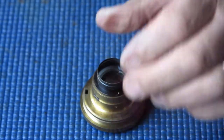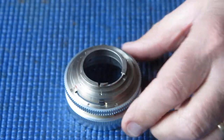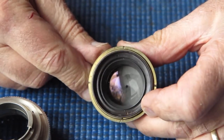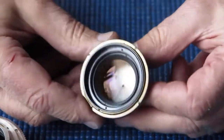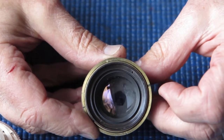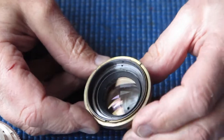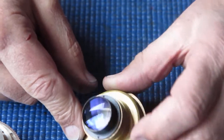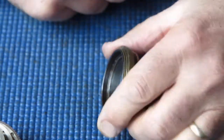The aperture feels quite snappy, so any reluctance to move is probably in the mount rather than the lens capsule. Before I put the lens capsule completely aside, I'm just inspecting the state of the diaphragm blades. There are some oily patches on those blades. I'll clean those blades without removing them from the mount because they are a lot of fun to reassemble. There are five blades, or five apparent blades, but each one is two pieces - so they're not fun. Pop that to one side and let's have a look at this mount.